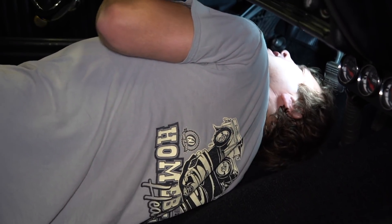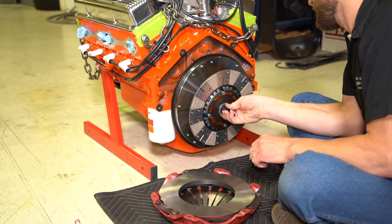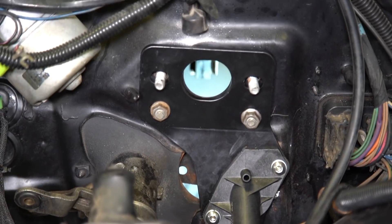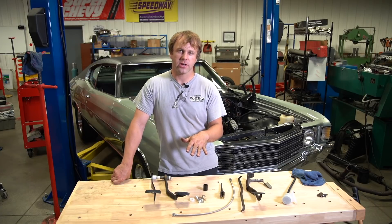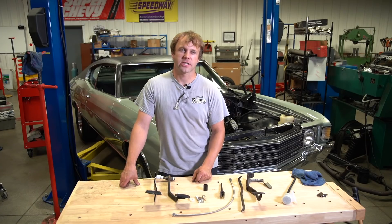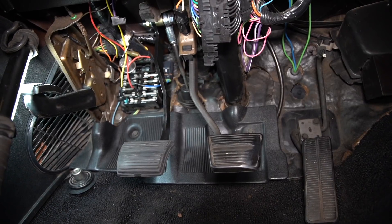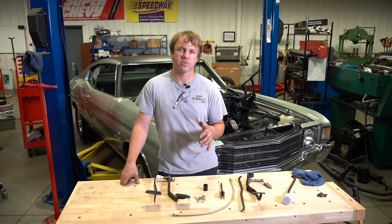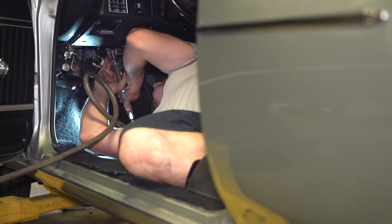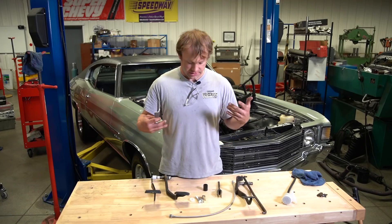Quick check-in on Project Chevelle. I'm over here installing the clutch master cylinder setup. Joe's over putting the flywheel and clutch onto our 383, getting ready to drop the engine in. This has been a sweet little kit so far — it bolts to the same four bolts that hold your booster or master cylinder on and mounts the clutch master cylinder pointed right at our new pedal. The hydraulic clutch setup is going to be way easier with the new transmission, giving us a nice smooth pedal feel and making it easier with the higher spring pressure clutch. It's all bolting on well — had to cut a couple small pieces of metal to get everything lined up, but nothing out of the ordinary.